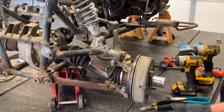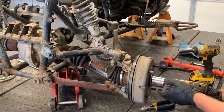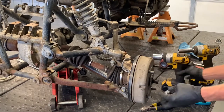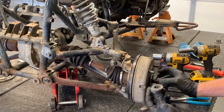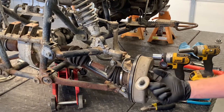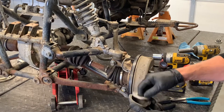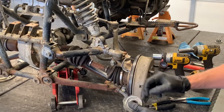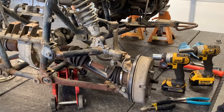We've got an inch and three-sixteenths nut here to remove, and I've got a half-inch drive to remove it. Remove that off of there. We've got your larger inch and three-sixteenths nut, a smaller washer, and then this is the washer that holds that cap on there — that cap sits inside that groove of that washer. We'll set that aside.